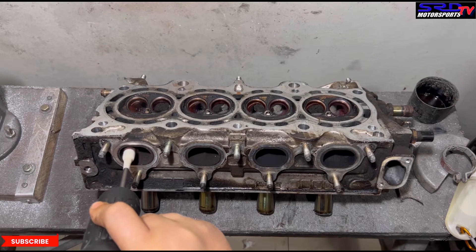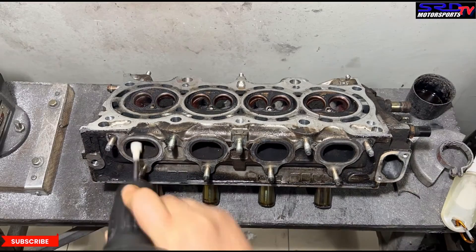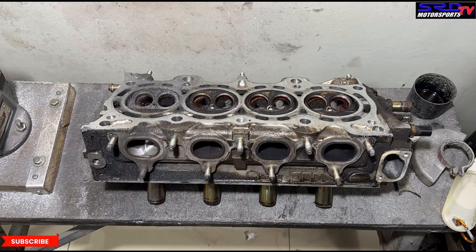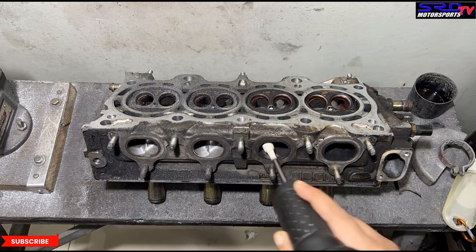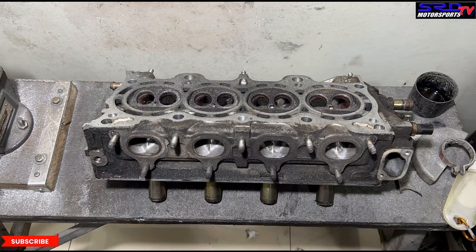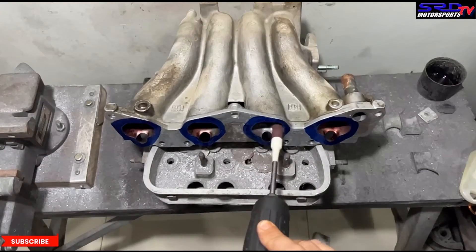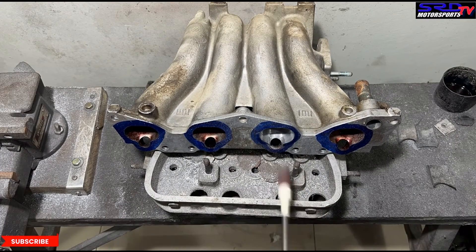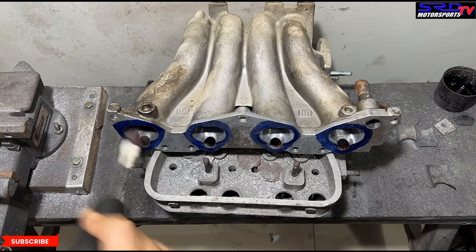On the exhaust ports I might port all the way through, but not with carbide — just clean it up with the sanding roll so it's all smooth. The exhaust remains non-VTEC, so it has to function well at lower, mid, and upper RPM to give us the efficiency we want. On the intake manifold we're going to smooth it out as far as we can reach into the runner, since we're not cutting the plenum open.